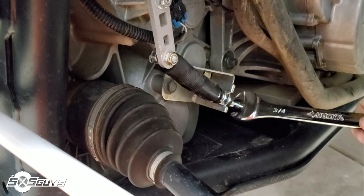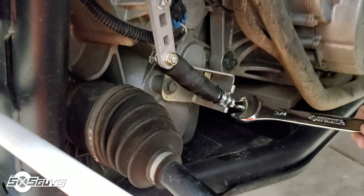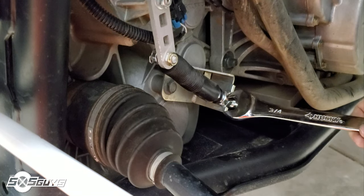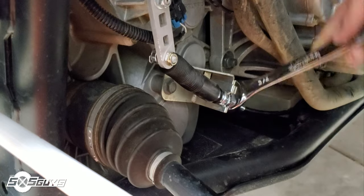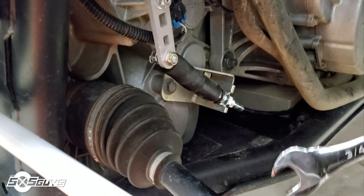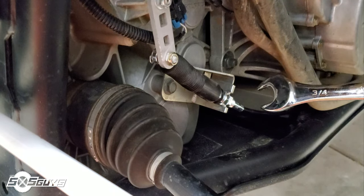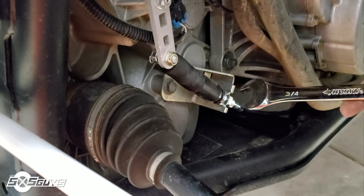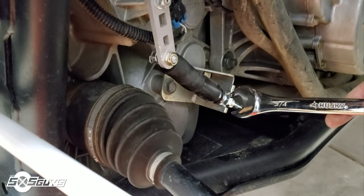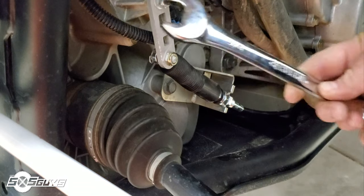When you get your shifting cable back on the bracket, you'll have about an inch and a half of thread — put it somewhere near the middle and lock it in. The bracket should have a double slot to hold one side of the nut so you only have to tighten one side; just do a light tighten to get it into position. Then go shift it and see if you can get into all your gears — park, neutral, low, high. If it doesn't get all the way into park, shorten it by moving the threads down and the nuts up. If you can't get all the way into high, move the threads and nuts down to give more length.